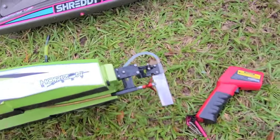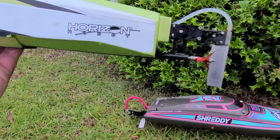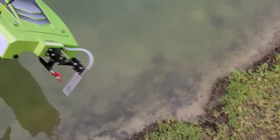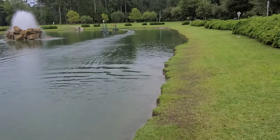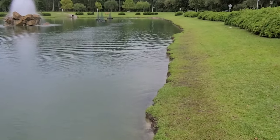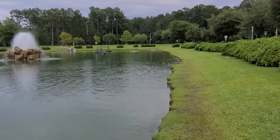What this is going to do is put a lot of prop in the water. When you've got a lot of prop in the water, depending on which prop you've got, it's going to want to pick the back of the boat up and probably push the front of the boat down with a really deep strut position on this boat. Keeping the batteries in the same position — yeah, it looks like it's wanting to push the front down a little bit and the back is raised up. I do this for the mono hulls but not too much for my catamarans, trying to help you catamaran guys out.